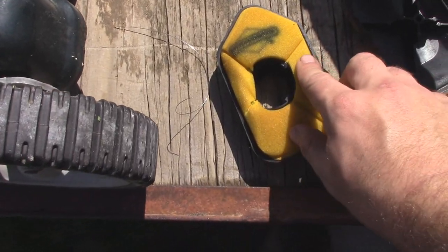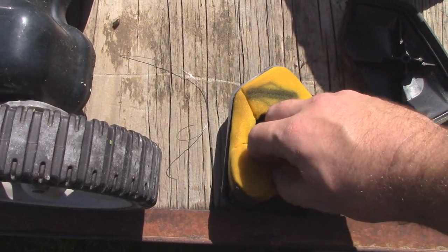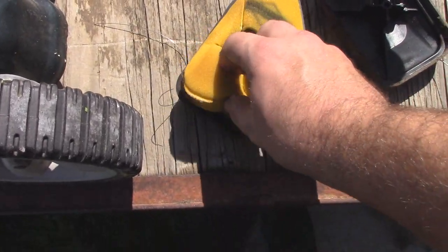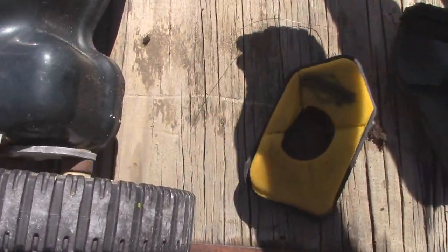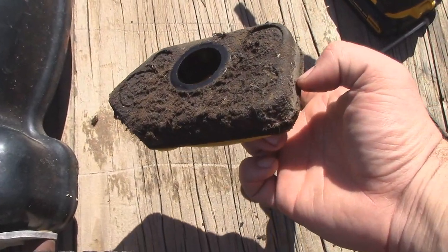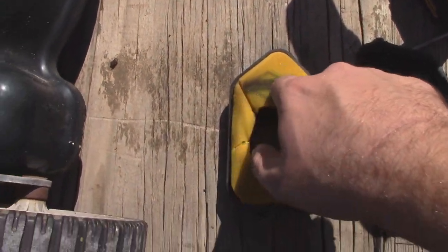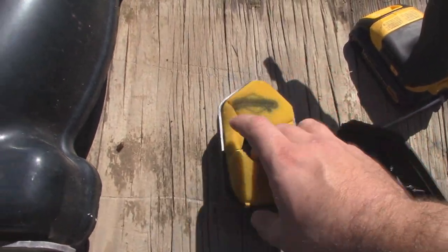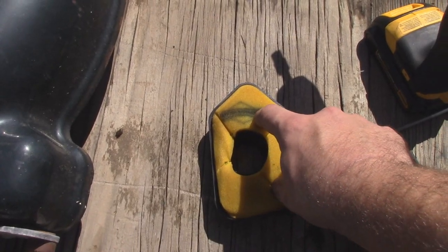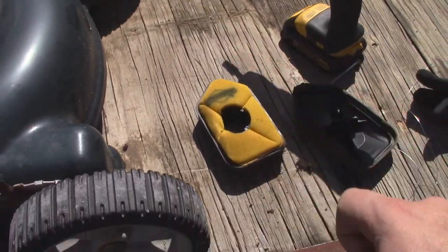However, the top of it looks really good. It doesn't appear that there's any oil in it — it might have all leaked out over time, and this might be the original air filter. That's actually kind of a good thing when it gums up with mud like that, if the user doesn't service it with oil, because it starts to act like a particle filter, believe it or not. You're honestly supposed to service these with oil, and I'll go ahead and do that and clean this thing off at the end of this video.